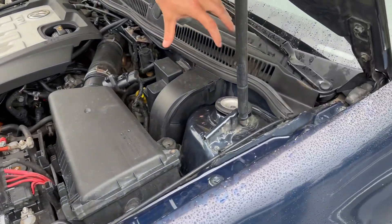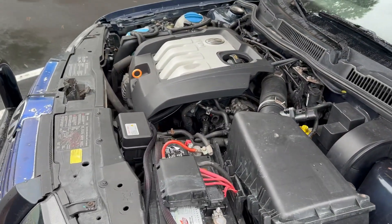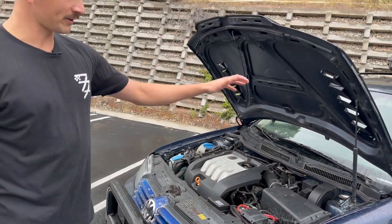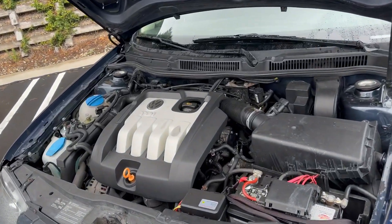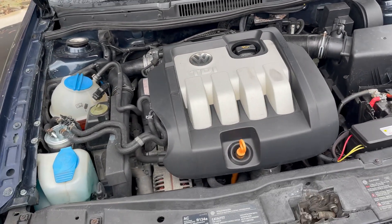It didn't run — it had excessive rodent damage. Rats had gotten in and eaten the entire wire harness up in the dash, so the car didn't even start. Had to get a trailer and tow it home. Had to redo pretty much every single piece of wire that went through the dash and tied into the ECU, but it took about a weekend of soldering, some crimping, and getting the wiring sorted — and she fired right up.